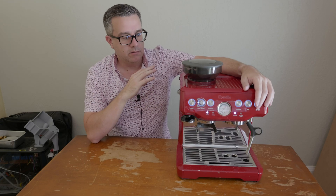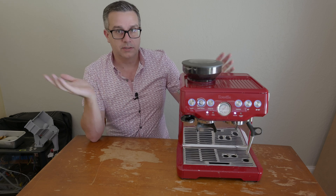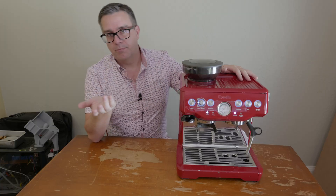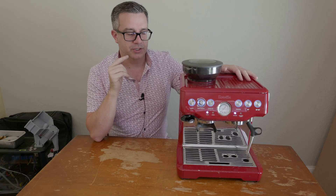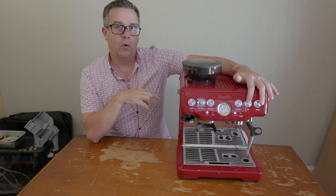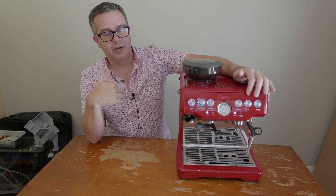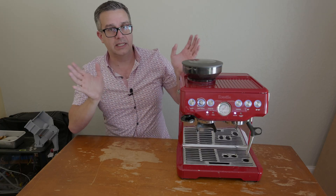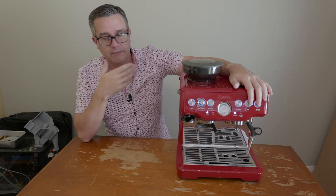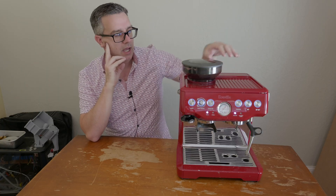The Bluetooth switch inside is pretty independent of the front controls — nothing I did affected the manual way everything works. All the buttons still have their original functionality, and once it's warmed up, everything still works as normal. One thing I had to address is the shot sequence: on this machine you long-press a button and it does a pre-infusion, then you let go and it does the full infusion, then you push again to stop. On my Ascaso you just hold the switch down and release to stop. So I did have to change the programming a little bit, but everything seems to be working really well. It still needs to be calibrated for the shot algorithm, but all the functionality is there.